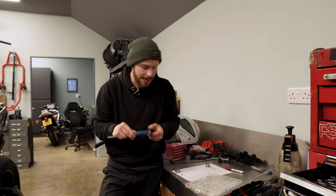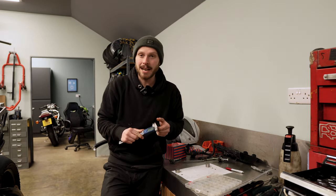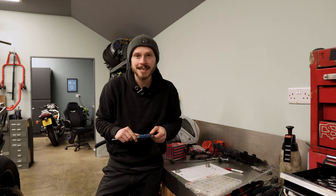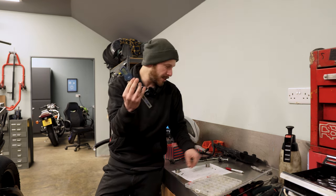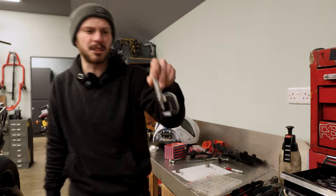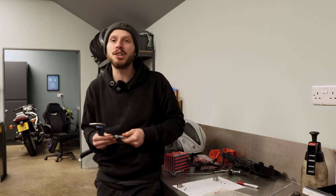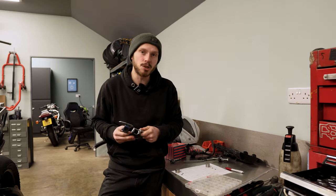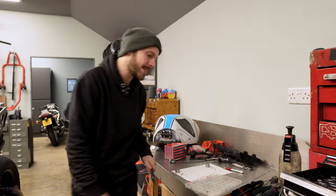I've now got the camshaft out of the bike and I'm trying to find the right shim to replace it with to get the gap set correctly. Something that seems to really annoy the internet is the fact that I use a set of verniers to check the size of the shims — but here's the thing: it doesn't matter what size the shim is. All you need to know is the difference between the one you're replacing it with. If the replacement is 0.05mm smaller, it will increase the gap by that amount. It doesn't matter if it's 1.6mm or 1.8mm — it's just the difference you need. It's so much quicker to use verniers than a micrometer. The micrometer is more accurate and tells you the actual thickness, but I don't need that — I just need the relative difference. And you always double-check with the feeler gauge afterwards, which is more accurate and real-time. I use the verniers as a quick reference to find the right shim from the box.